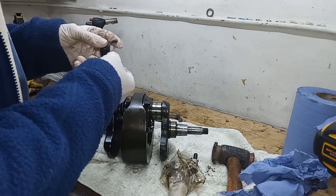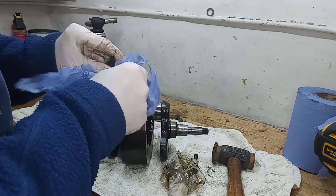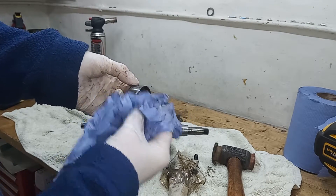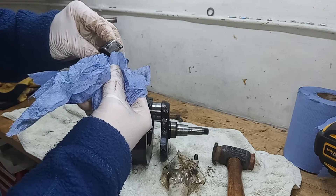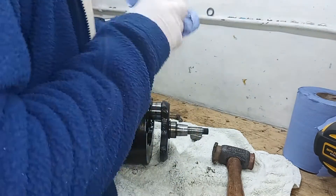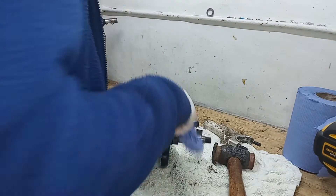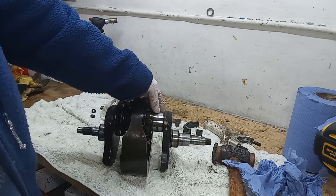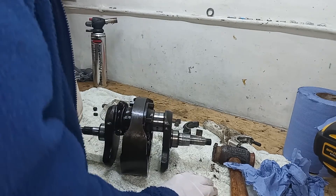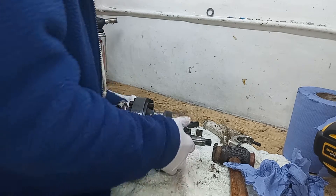Let's take the bearing shell out and check the part number - I'm pretty sure that is a standard shell, so I'm fairly sure the big ends have not been reground before. But you know, it's all looking okay. We'll definitely be replacing the shells. The crank either needs honing - though there's some quite deep scoring - or it may need regrinding down to the next size, which means a smaller journal and larger oversized shells.